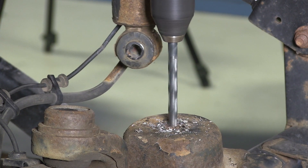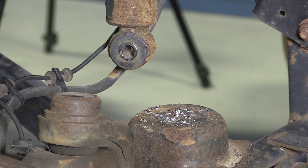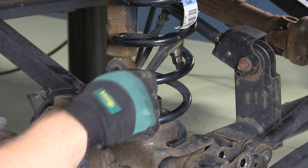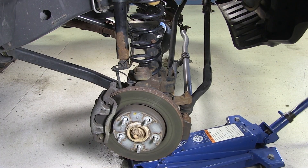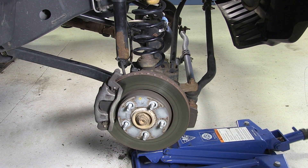Consider using pilot holes and drill the bump stop pad using a 25-64th drill bit. Replace the coil spring and place the bump stop inside. Attach it to the axle using a 10-millimeter button head bolt, one washer, and the 10-millimeter nut. Use a floor jack to raise the axle so that the full weight of the Jeep is on the coil springs with the newly installed spacers.